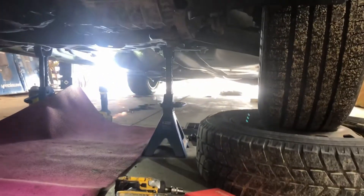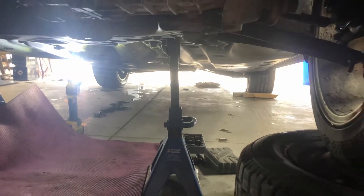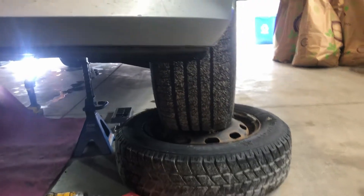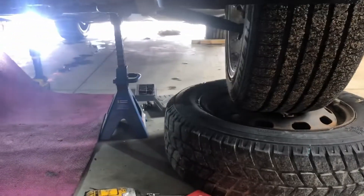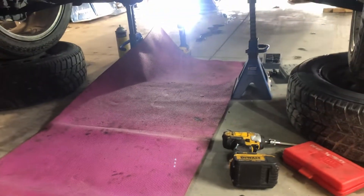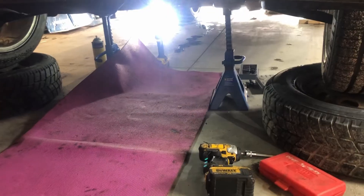I'm going to start at the back half — it's a lot cooler than the DPF right now. I'm doing this in my garage without a hoist setup yet, so we're using jack stands on the subframe. Especially with them being so high, it's kind of sketchy. I like to stick tires underneath here so that if it does slip, at least I don't get crushed — especially with nobody home but myself. Safety first. Creepers are nice but you lose height, so I'm using a yoga mat. We're going to try and get the connector and the flange between the DPF and the SCR and CAT undone first.